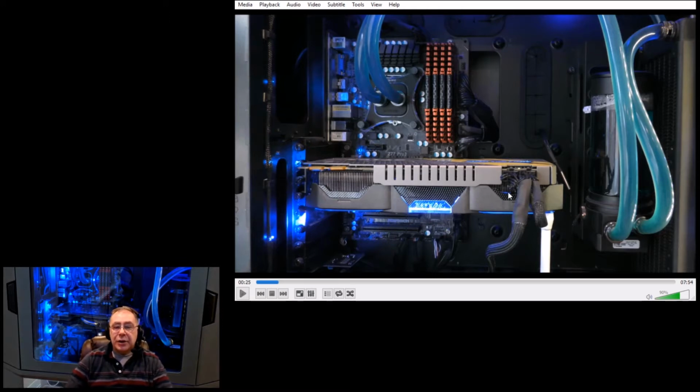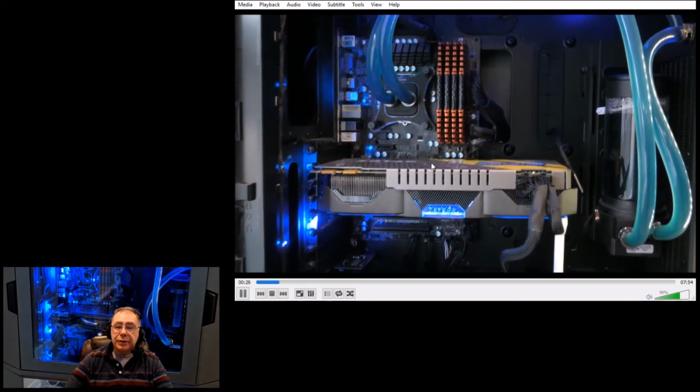So basically I've got to remove this graphics card, turn all the power supply off, make sure you unplug the power supply, leave it 10 to 15 minutes to make sure all the electrics is drained out of the power supply, because it does hold a charge. I did put a tester on it just to make sure it's completely dead. So like I say, you're going to move that, take the RAM sticks off, unscrew these here, wind these off. If you've ever done anything like that before, it's quite easy. And it's going back on again as well, so we'll carry on with the video.